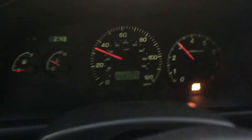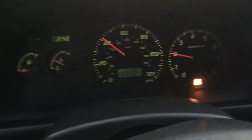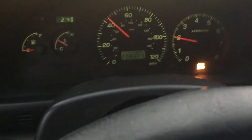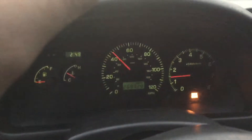It's a little firmer shift. As you can see it holds shifts up a bit more — not really giving it a whole lot more throttle. This is coast down. It never went into lockup. We're about 1400 RPMs holding.